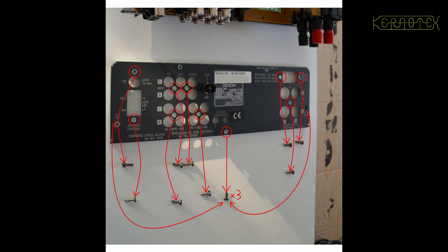This slide will be shown again later as a reference during reassembly. All the connector screws are the same, except for three small black chassis screws — one in the middle and one either side towards the bottom. You can see the thread is much wider on those, as they're presumably self-tapping screws into plastic.